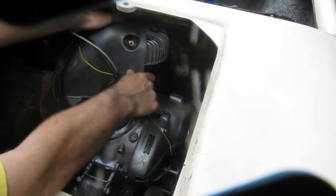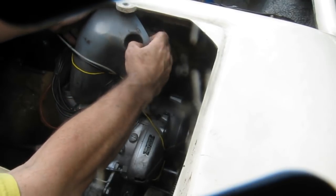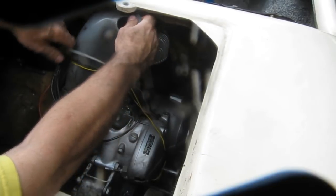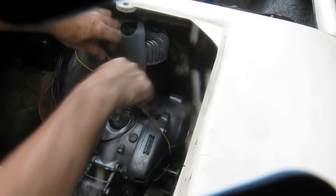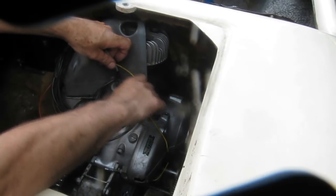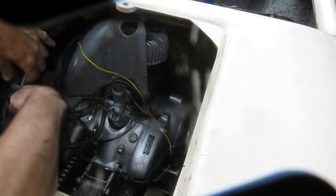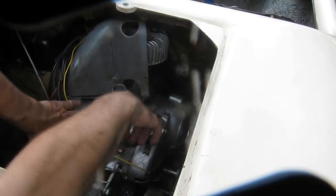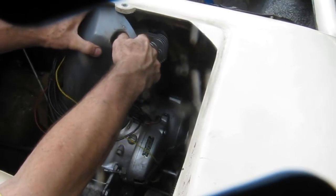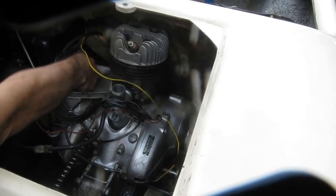Now, this half of the cooling shroud should come up out. It's a little convincing. Actually, I'm going to take the top disc off the carburetor here. We're going to take the carburetor off anyway. Just unscrew this top ring. Take the ring off, and then the disc with the choke and throttle slide slides out. Set that aside. Put this wiring down out of the way. Oh, and it'll almost come out. There we go. Thankfully the two screws here weren't there.